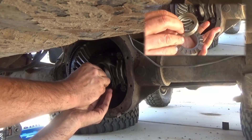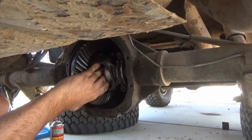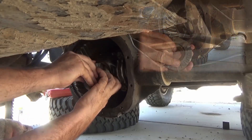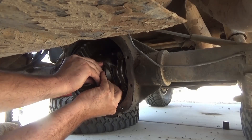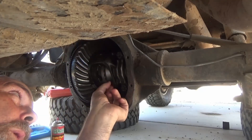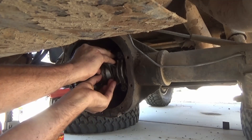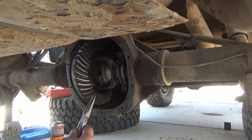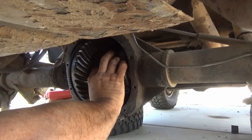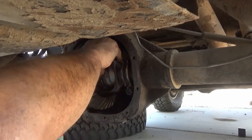Over in the inset in the upper right-hand corner you'll see how you put that round disc inside the side coupler. Then you slide the side coupler in on the side towards the ring gear, making sure the splines line up between the inner coupling and the side coupling. Then do the same thing with the side opposite the ring gear. Once the two inner couplings are in place and lined up with the teeth on the outer couplings, you can rotate left and right until the center pin hole on both inner couplings lines up. Now pull out those pins — the springs will push the pins out and lock the two inner couplings together.